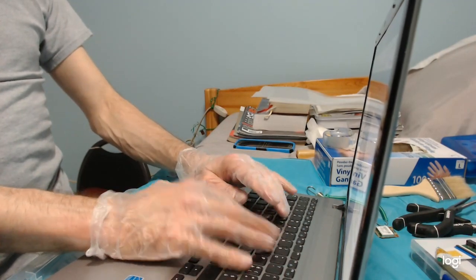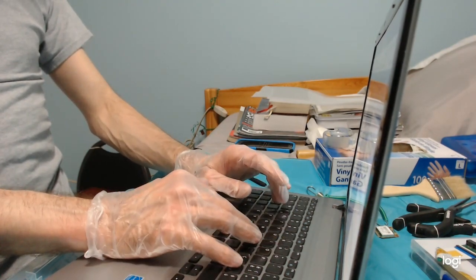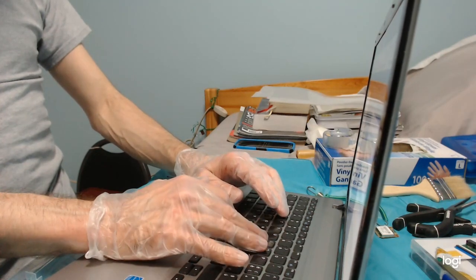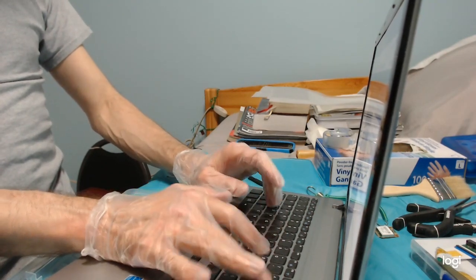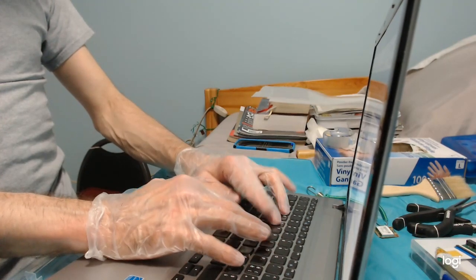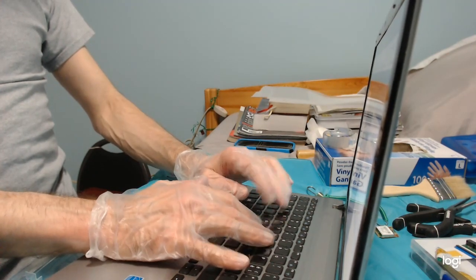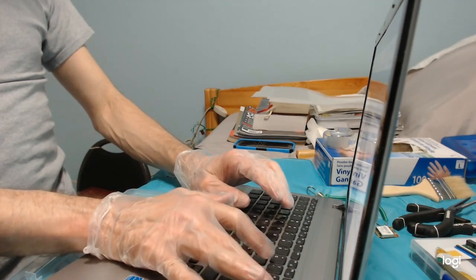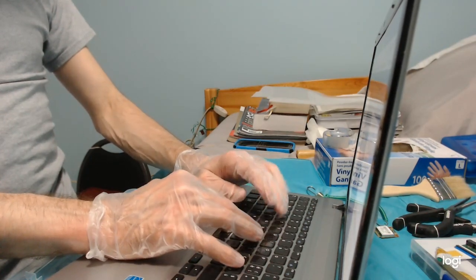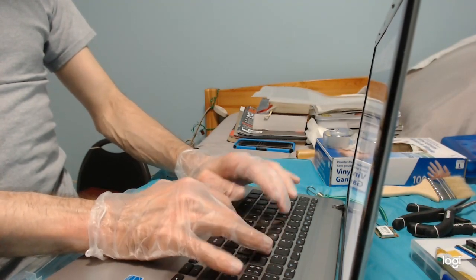I don't have a space in the laptop to hold it because there was a corner. I could reach it by attaching the mini PCI Express extension ribbon first. But if I attach the extension, the computer sees the drive, creates the partition, but fails to format it. And after a while, it disappears. It doesn't even see the drive anymore.